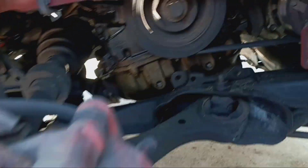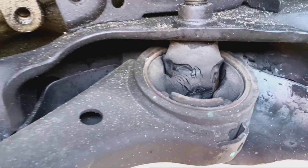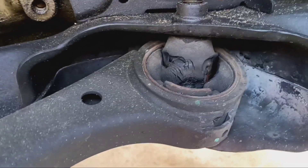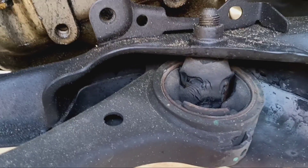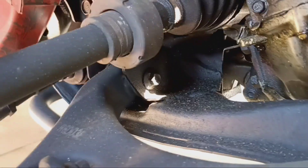Okay people, we got the wheels on. This is the problem right here — this front bushing, it's all tore up. We got the new arm, it's already got pre-bushings pressed in. So let's get this all apart, got the bolt back there.